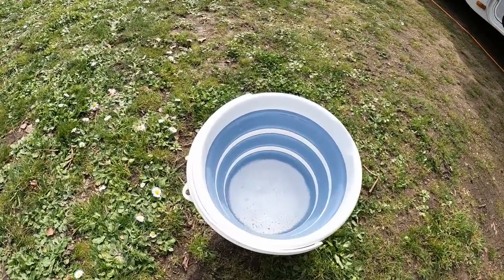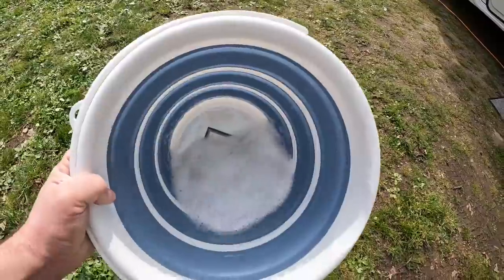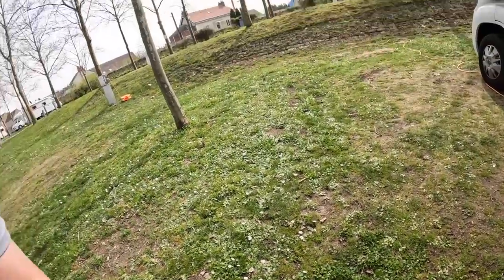I put a few tablespoons into a bucket to dilute it down so I'm not putting raw powder directly into my onboard tank. Once you've got it in, there are various ways to mix it around. Some people will take the van for a few miles spin and let the water slosh around everywhere, but because we live in the van it's not easy to be without water for a length of time. Normally we'd leave it in the tank for 24 hours, open all the taps to make sure it's in all the pipes, shut it down, and leave it.